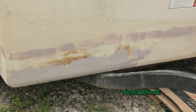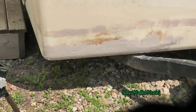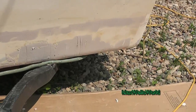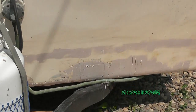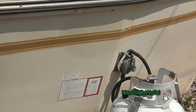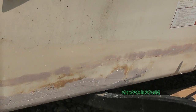We're going to let this dry for a little bit and then probably come back out here and give her a sand. The Bondo's dried off enough to work. Just give it a good old sand. Of course there's going to be some areas that need some extra sanding where I put it on a little bit thicker, but that's no big deal when you have air tools and you're not hand sanding. There's probably going to be a couple areas that may need a spot touch-up and end up needing a re-sand. So I'm going to throw you on the tripod here and get sanding.